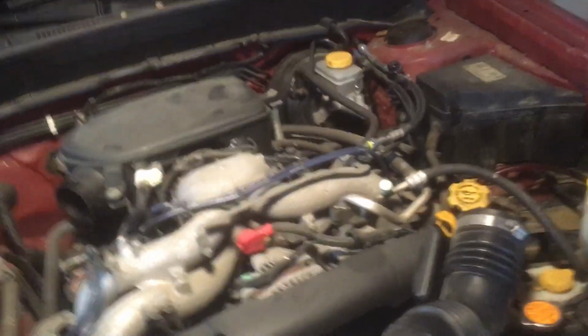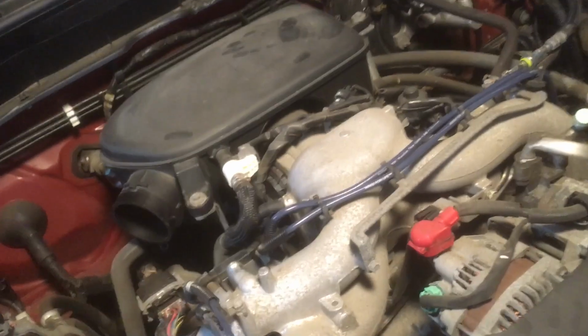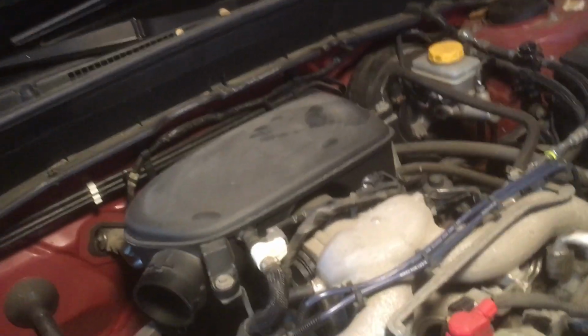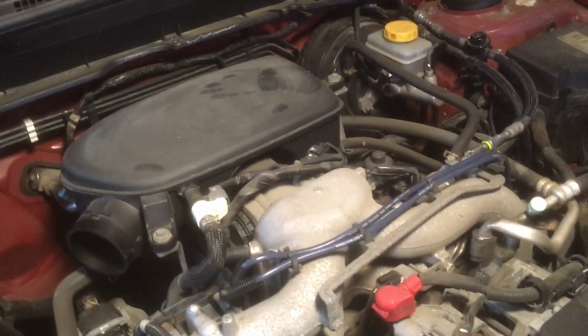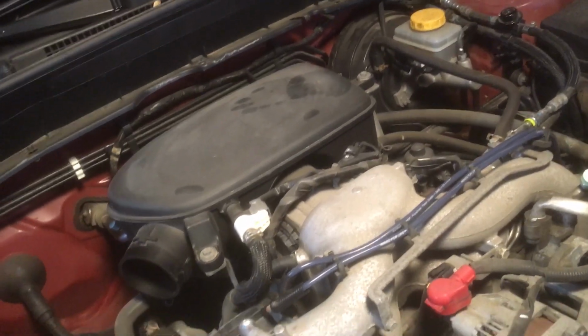Doing some surgery on the Subaru. It's been having a misfire on cylinder number 4. And I had a friend of mine look at it, who's an auto shop teacher. And he found that the number 4 spark plug wire is loose. Alright, cool. It's run decent enough since then. And then today on my way, while I was out of town, it pulled the little stunt again where it misfired, check engine light, all that fun stuff.